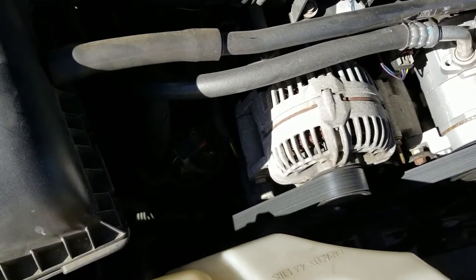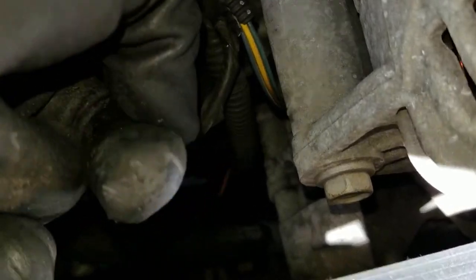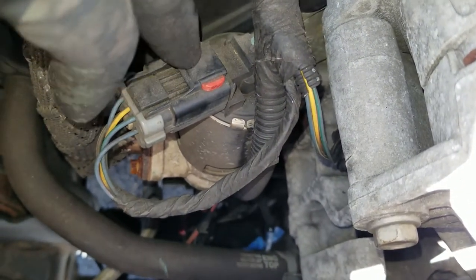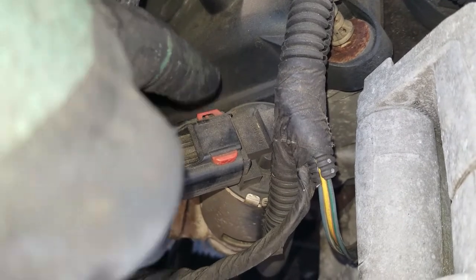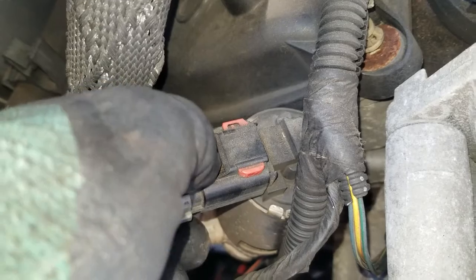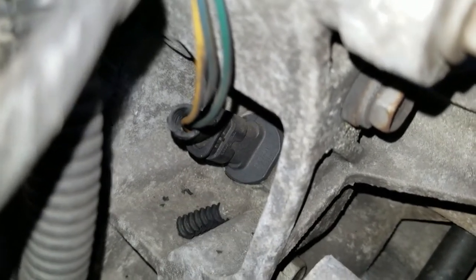Obviously I'm up on top now — I'm standing on the front bumper looking down at the top of the engine. Here's the alternator here, and here's our harness. You can kind of see that portion we were working on down below — it's hanging down now. We've still got a couple connections here. I think this is the EGR here, and it looks like it's got this little safety tab. I need to pry on the red tab on the backside and slide it, and then I can squeeze here and disconnect that. And then I've got another one right there under the alternator.